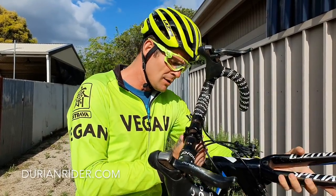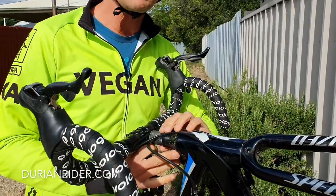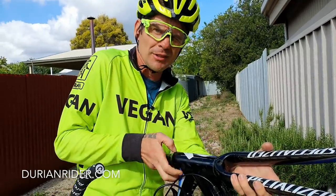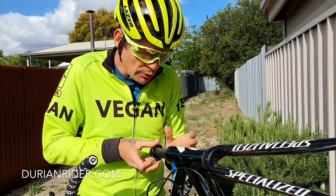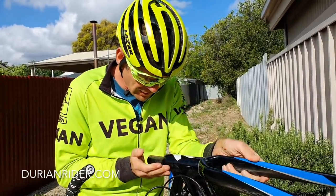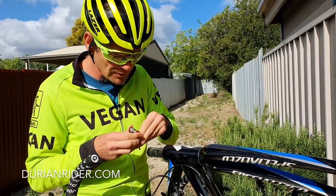We're going to gently lift that fork off like so. That looks really good so far. What we're looking for is the famous Ring of Death. I'll take off our caps. This isn't looking good — we could have a Ring of Death on our hands. There's corrosion in there. This could be a Ring of Death. That means this fork is going to go into landfill, unfortunately.